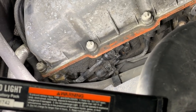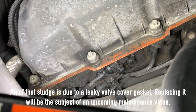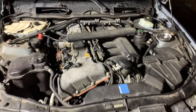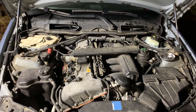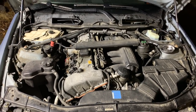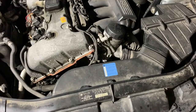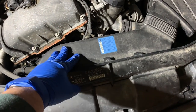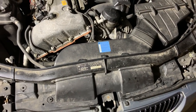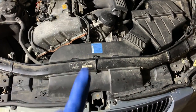The Vanos solenoids are right here on the front of your engine. There are two of them, they're actually identical, and they just bolt right into the front of the engine. Before you get started you're going to want to take off your engine cover, which I've already done. If you want to see how to do that, go ahead and watch part one of my BMW maintenance series. The next thing we're going to do is take off this portion of the air intake — it's not an absolute requirement but it'll make your life a lot easier in cramped quarters.